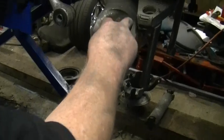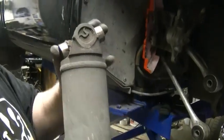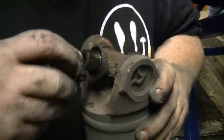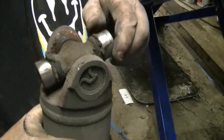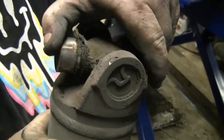You have 8mm bolts with straps that hold these U-joints to the spindle and in further to the differential. I had already taken those out — those you have to use an 8mm wrench and they take time, so have patience. Then pop your axle out. Feels pretty crunchy. Definitely wear. This is the cross piece where it's really worn — you can see it there.